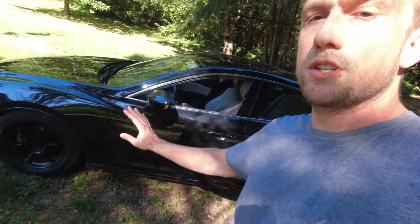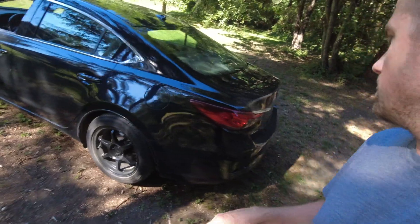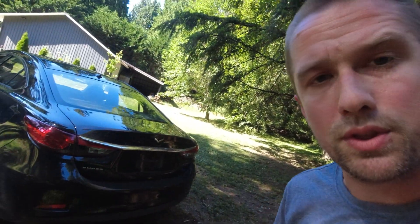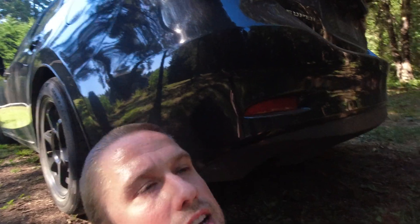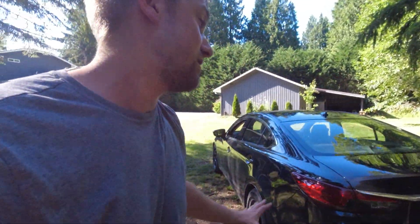Now if we come around, it may not be super visible from this angle, but I'm running about minus three camber in the front, about minus two in the back. Now I do have a bit of an unorthodox exhaust. At the time that I did it I was trying to be cost effective and figured I'd change it, but now I've kind of gotten used to it and really love the fact that it's hidden. So this is just a Thrush turbo muffler. We cut the flange off of the stock exhaust and then put a simple turn down. So what I end up with is effectively a hidden center exhaust that sounds amazing and is super super light and tends to throw people for a bit of a loop because they can't see that there's any exhaust, and it sounds really amazing.